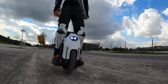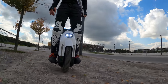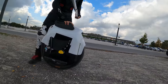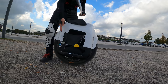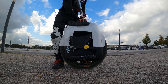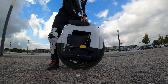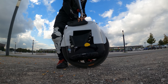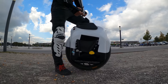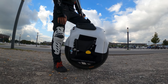You can also select the pedal angle. I ride with my toes lower than my heels because it makes accelerating easier. You can also have the wheel flat — a good all-around setting — or tilted upwards for higher pedal clearance when heavy off-roading or climbing stairs. Try tilting it front and back, ride 10–20–30 kilometers with each setting, and select your favorite.